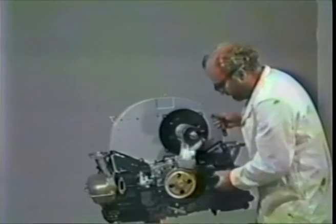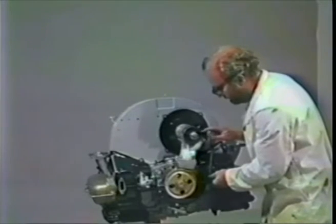So you get me for a judge, and you got those kind of screws there, and I noticed them. You'll find that you may get docked a few points because they aren't original. The factory didn't use self-tapping screws. They use a separate non-self-tapping screw that I'm using here and a separate washer.